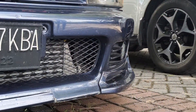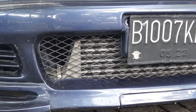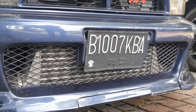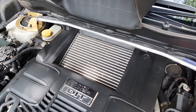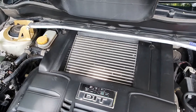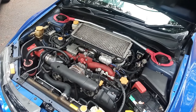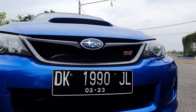Other than the cooling method, the placement of the intercooler also varies. With this Gallant VR4, it has a front mount intercooler setup where the intercooler is right behind the front bumper, so it has access to all the fresh air passing over the car. Meanwhile on this Forester and this STI, the intercooler is on the top of the engine, also known as a top mount intercooler. Top mount intercoolers usually require some kind of ducting or a hood scoop to push cold air through the fins.